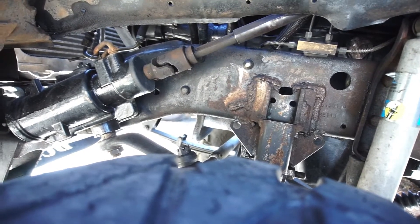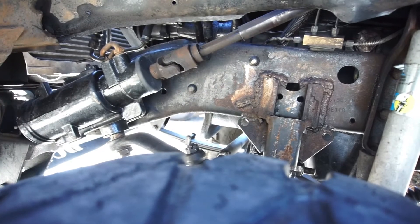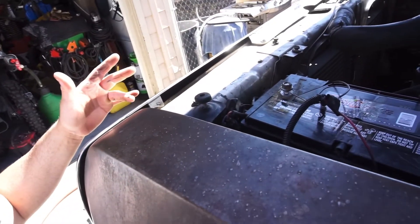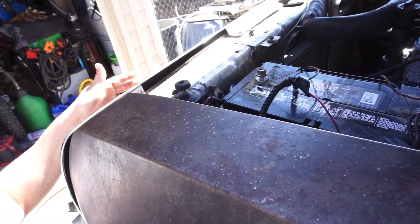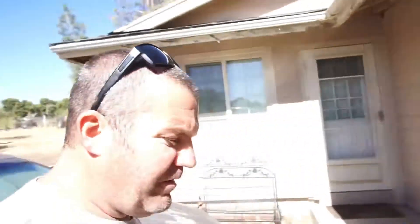It's got a lot of wiring issues — just a lot of nonsense wiring going to nonsense places. The headlights I think are HIDs which don't need to be, so we'll probably delete those and put it back to factory. It had an LED bar light where the fuse was completely melted, and it looks like it's hardwired with no switches — everything's just hardwired straight to the batteries.